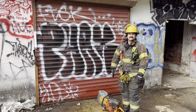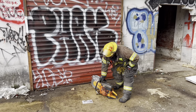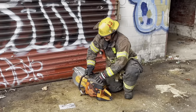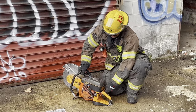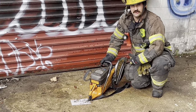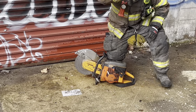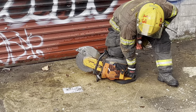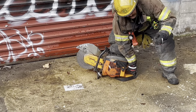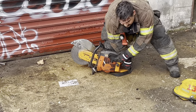If your saw isn't working, a pretty common problem is a flooded start. If you think your saw might be flooded: decompression button is in, choke is pushed all the way in so you're getting full air into the saw. At the same time, squeeze and hold the trigger with your pinky — full throttle, full air. Crank it until it starts. Guaranteed start.